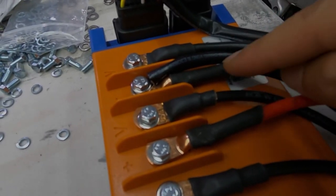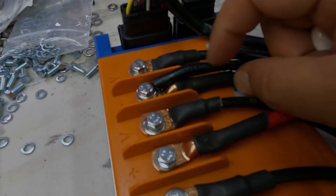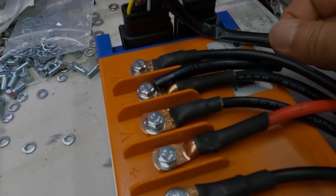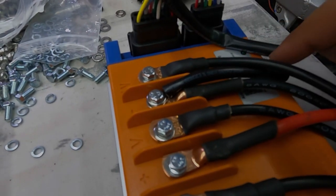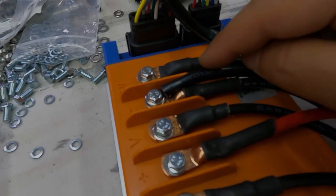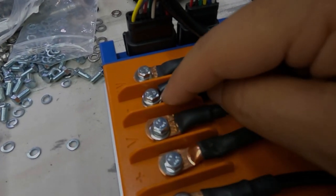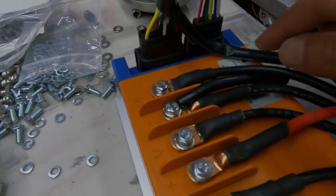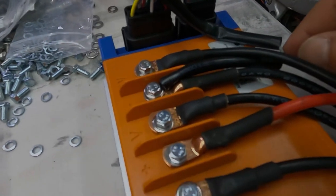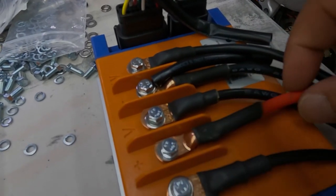It's very important. So it's blue, red, green, black, yellow, and then the ground wire. As you can see, I have it coming from the 16-pin harness underneath the yellow. This is gonna be yellow. Yours are gonna be color-coded. And it goes on top of the ground wire. So this is what it looks like. So make sure you have that wired correctly, especially this power wire. This has to be on the positive.